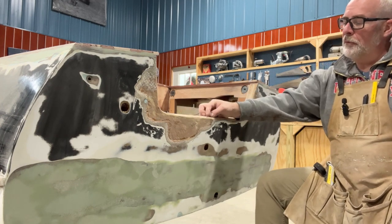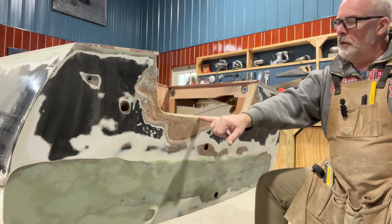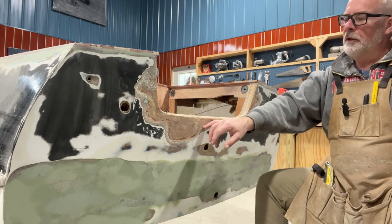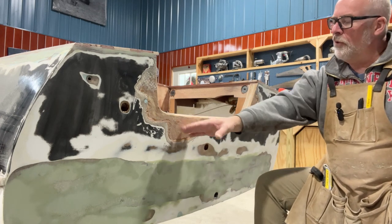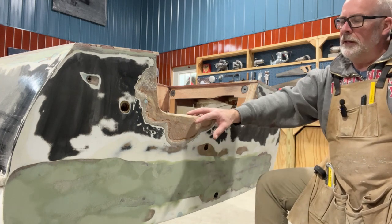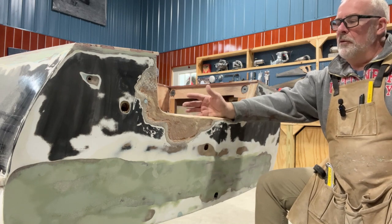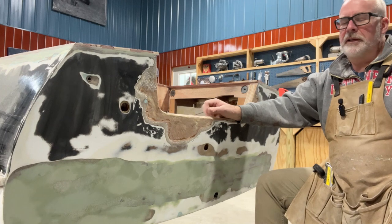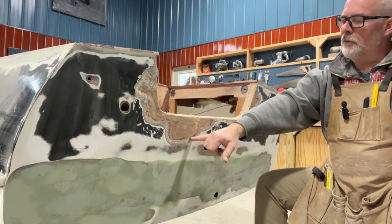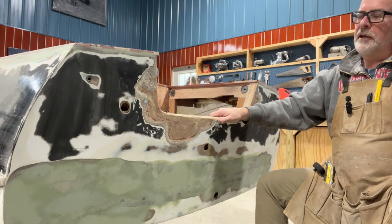While doing that, the original laminate I had used with my new core — cracks started to appear. Not exactly as bad as the lower part, but a minor separation. So I chased it all the way down, and you can see there was some delamination, probably two or three inches down from that lip. That might have been some wetness that got in there in the last 20 years, or because the glass is so shiny, I'm assuming it never did connect properly back in 2002. I'm going to continue chasing these down — they're very close to hitting good adhesion from core to glass outer.